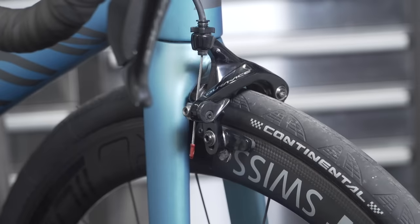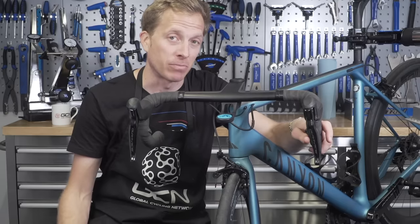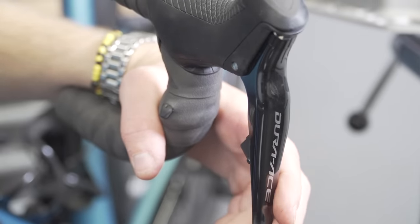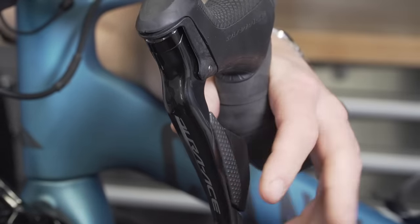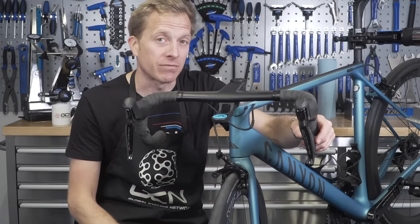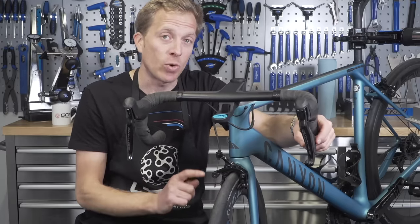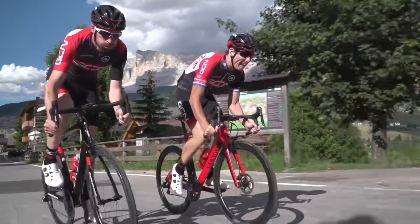When it comes to how close you want your pads to the rim, it's basically a case of personal preference. Some riders like to just touch the brake a little bit and then those pads touch the rim, whereas others like to almost touch the bar before the pads start touching the rim. One thing to take into consideration is if you do like your pads very close to the rim and you've got a pair of flexi wheels or a flexi frame, they could well rub when you get out of the saddle climbing or in a sprint — so just bear that in mind.